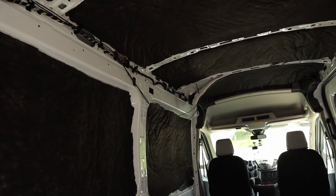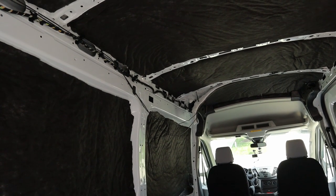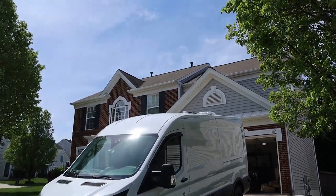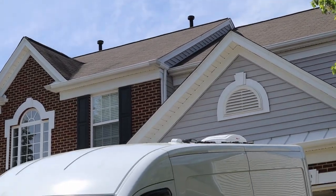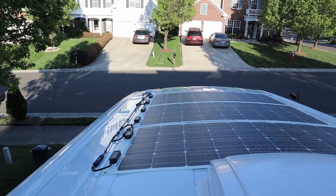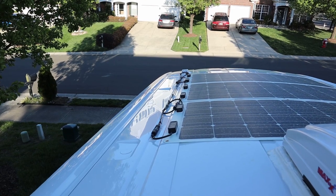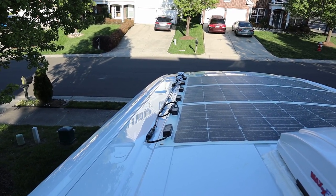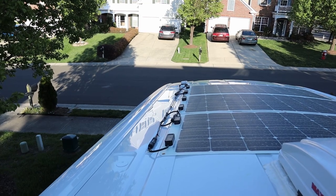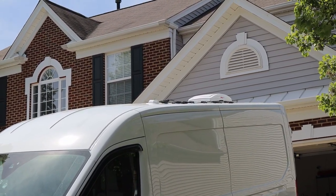You can see that I pulled the cable in for the solar through the roof last night, and I actually cleaned up the cable this morning. Here we are with the solar wiring all tidied up from the outside — got it pulled through the conduit and hanging on the inside. Waiting on the batteries and all the other electrical components. I left service loops in there in case I didn't cut any length off the Renogy supplied panels, just in case I had to send a panel back. Even made a trip to Home Depot and nothing blew off, so I'm feeling pretty confident there.